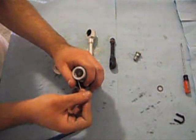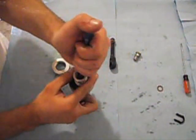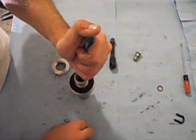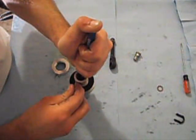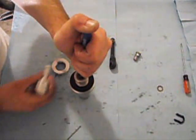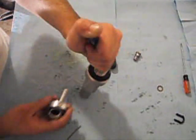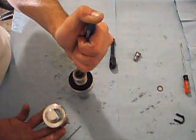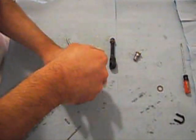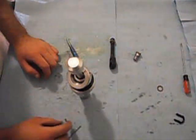take a small Allen wrench like this one here, and you may have to compress the plunger assembly slightly. And just slightly push the pin up to where the plunger will start to come out. You're going to want to put the ring around the plunger arm like so. Okay? Take the plunger, compress, drop your pin in, let go. Okay, now you have it assembled inside the car through the clutch pedal assembly.